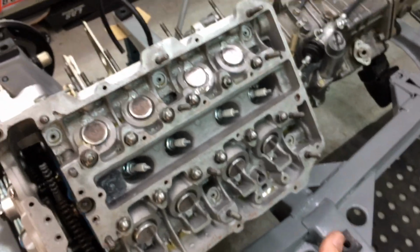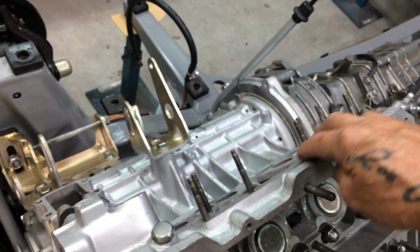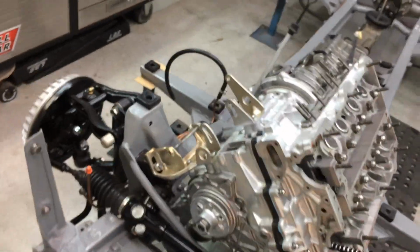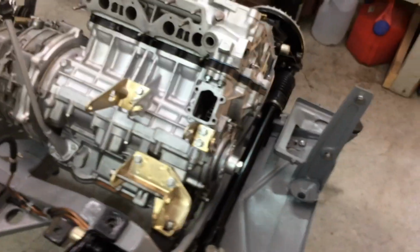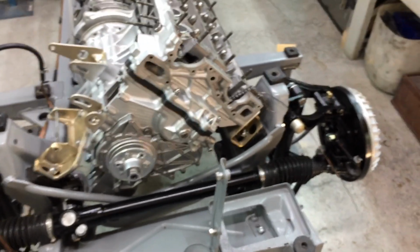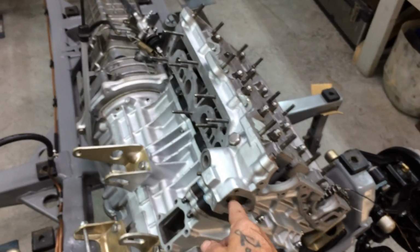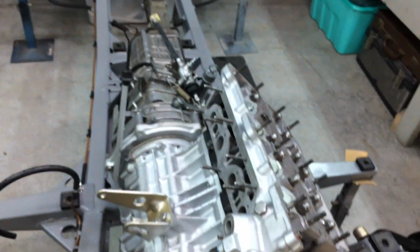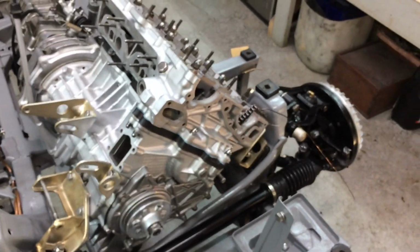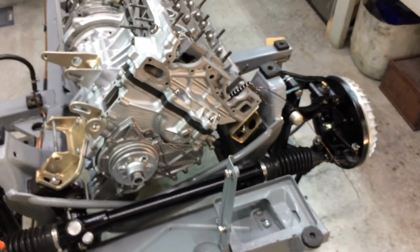If it leaks under there, and I'm pretty sure the drip on this side was this gasket, I'm going to use that Permatex on both sides of this gasket. But that's enough for today. I've got it to where I wanted it to be. Tomorrow I might even put the cams on. I'm just going to put the water pump on, the housing here, and this, and stick the radiator on and see if it leaks. That's what I'm doing. If it doesn't leak, then I'll put the cams and stuff on.